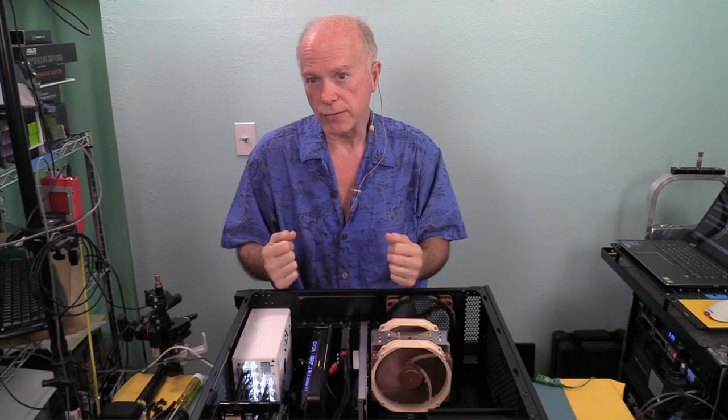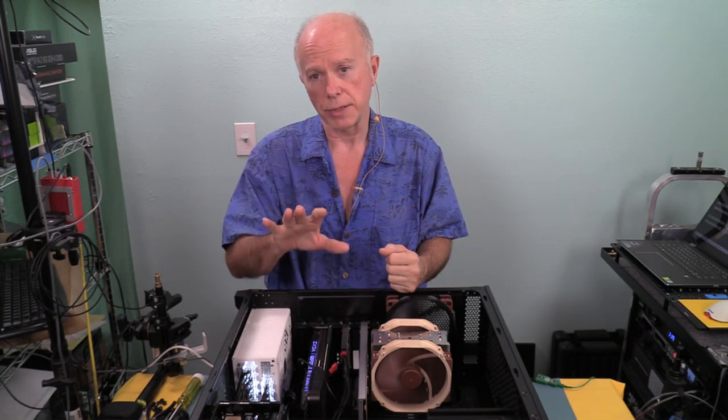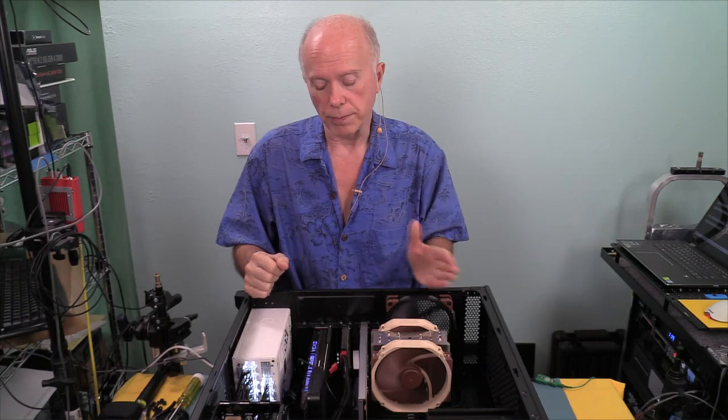So when someone says I have an X570 chipset, my first response is the motherboard, because I look at the brand, the model, and revision. And historically, bifurcation is a feature that is probably enabled the most on motherboards, number one by ASUS. Beyond that, then it gets very specific on the chipset. For example, if someone says, well, I've got a Gigabyte motherboard, I have to look it up. But generically, bifurcation is a feature on the X299, X399, PCI Express 3, and as we go forward on PCI Express 4, the high-end desktop would be the TRX40, and on the workstation, the WRX80.